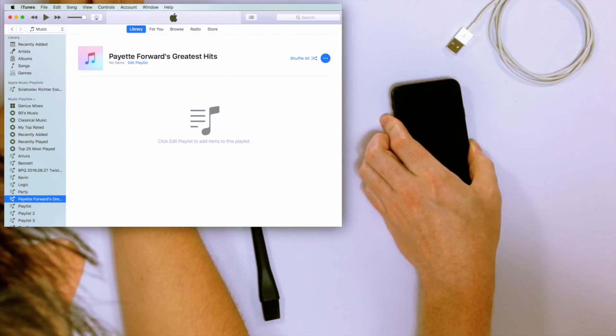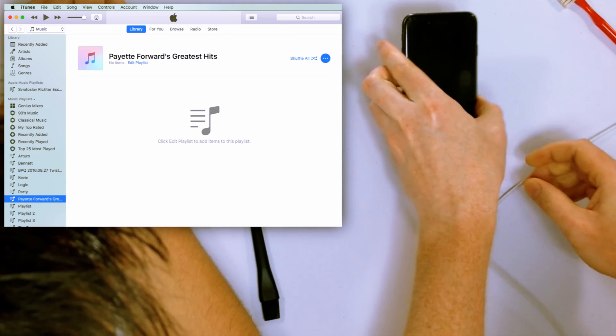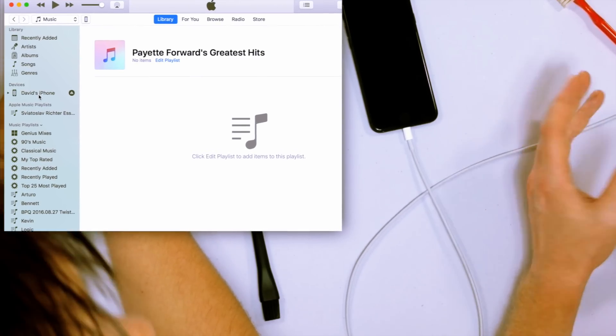After examining all those components, the next step is to plug your iPhone into your computer to see if it gets recognized by iTunes. A lot of the time your iPhone won't turn on but it's actually already on — if it's making noises like beeping or ringing, the screen might be black due to a display problem. Plug it into iTunes using a good cable and check the left-hand side — under Devices, your iPhone should appear. If it does appear in iTunes but nothing is happening on the screen, you probably need to repair your iPhone screen.